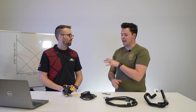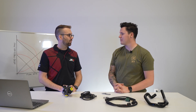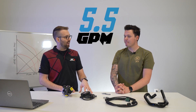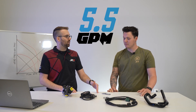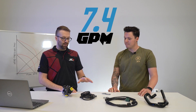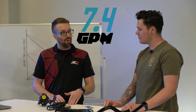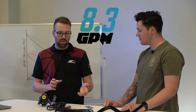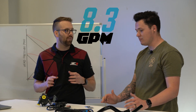What are the actual numbers compared to stock? The stock non-Red Sport single pump system flows about 5.5 gallons per minute. The Red Sport factory dual pump system flows about 7.4 gallons per minute. If you install our kit and replace that second Red Sport pump with our pump, it flows about 8.3 gallons per minute — in an otherwise completely stock system, with stock heat exchanger, coolers, and everything like that.